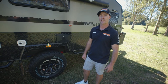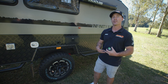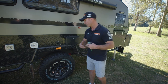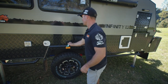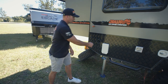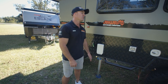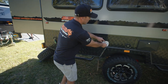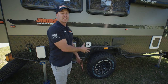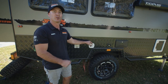The Infiniti range has two water tanks that are 120 litres each. When using these, we're taking the cap off and using food grade hose and a filter before feeding the water in — if you're wanting to use it as drinking water, I recommend sterilising the tanks. If not, it's just food grade hose in, filling the tanks to 120 litres. Cap on for the rear tank — cap off — 120 litres. Inside, you can switch between the tanks, which we'll go through when we get inside the van. Otherwise if you're at a caravan park or have a supply of town water, we simply take off the little dust cover — we don't need any water in our tanks, we're bypassing those and the pumps. A little male threaded fitting in, connecting up here. Our mains water inlet is fitted with a pressure regulator, dropping the pressure to 50 psi so it won't blow any of the lines inside the van.